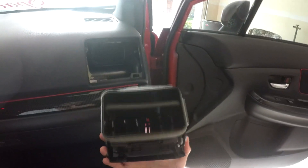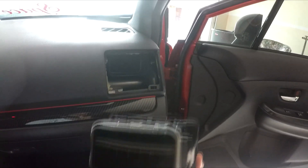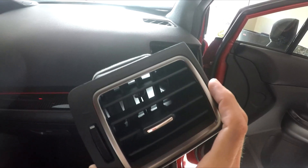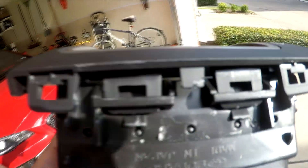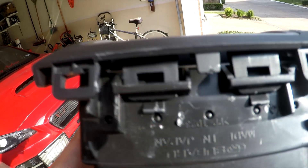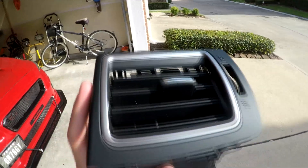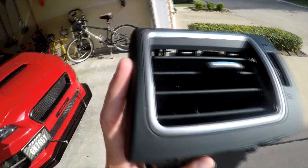Now I'm going to start working on the back here and let you know how it all works to be able to get this plastic trim off. On the top you can see there's two clips — one there, one there — as well as two on the outside. Just use a flat head and pry at it. It doesn't matter if you leave a mark since you're not going to see that part. As well as on the bottom, there's two pieces at the bottom right there. Once you have those released, just pull with a little bit of tension as you're doing this and you can kind of wiggle it out.